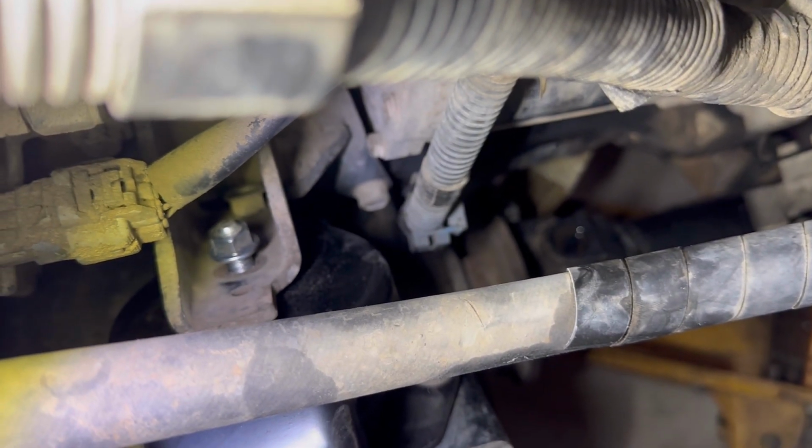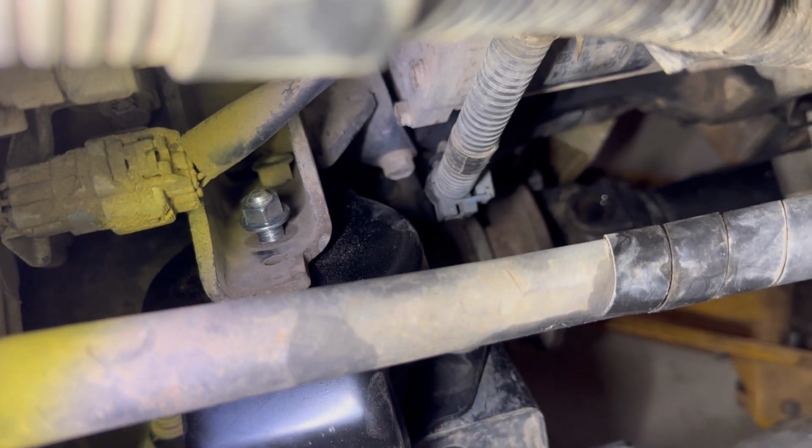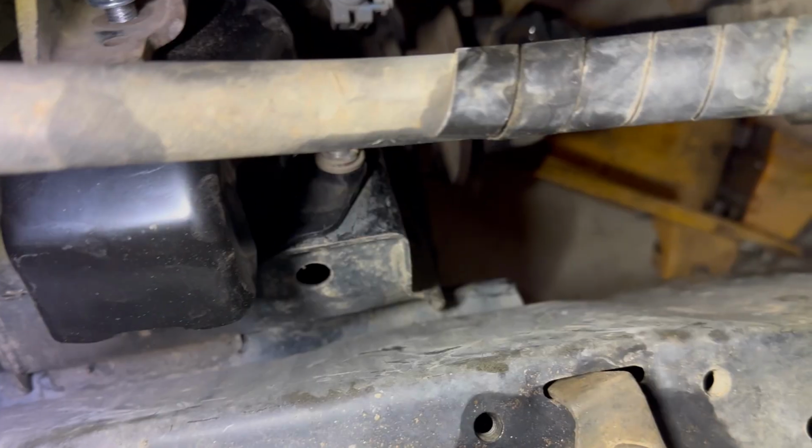Okay, so really difficult to get that mount, all the bolts lined up. So if you can see, or if you can. Took a lot of focus. Took that bolt completely almost off. Jacked the motor up quite a bit again just to give myself enough movement in the mount, just to wiggle everything around and get the 3 bolts in place. I'll just now tighten it up and go do the other side.